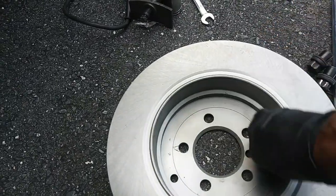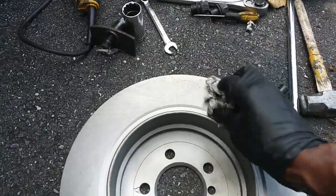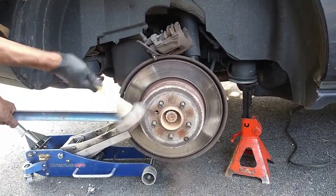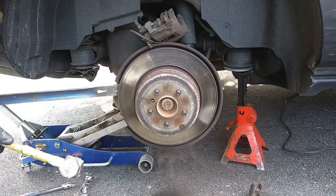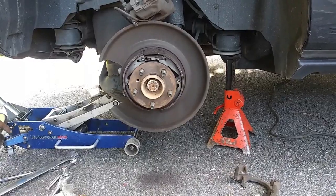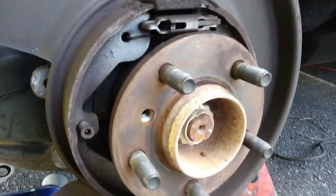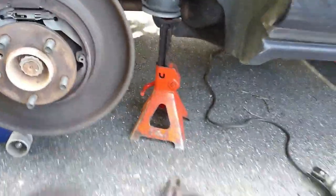The only difference on this car now is the rear brakes. This is the rear rotor, and the only difference doing the rear brakes on this car from the front is that the rear rotor has the park brake or emergency brake built into the rotor. I'm popping the rotor off so you can see that — inside here is the park brake. The park brake is only for when you're parking. To do the brake pads and everything, it's the same exact job as the front, so I didn't bother to show that.